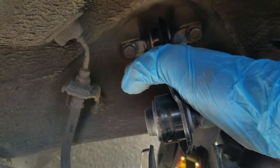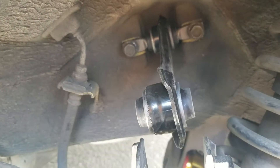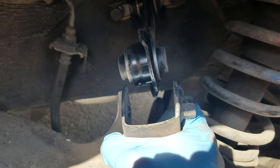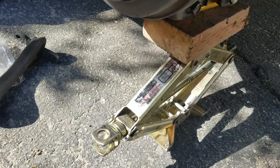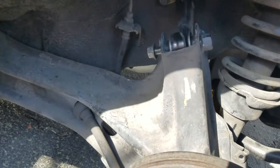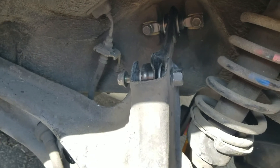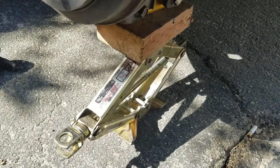What I decided to do is attach the control arm to the frame first with the bolts not fully tightened, then I can work on wrestling it into position. I needed to raise the jack via that block of wood and the lower control arm to raise the trailing arm up to meet the upper control arm. I won't torque it until everything is at the right ride height.